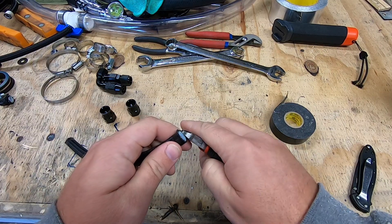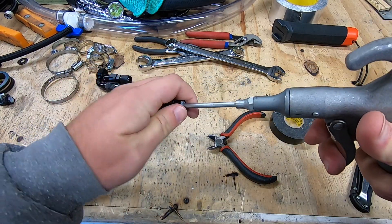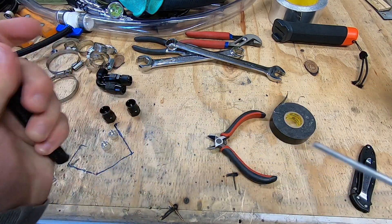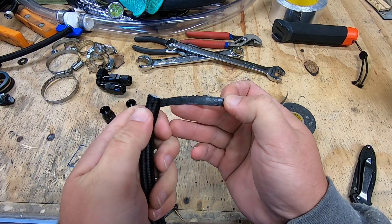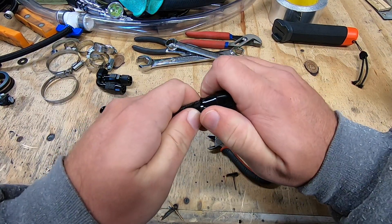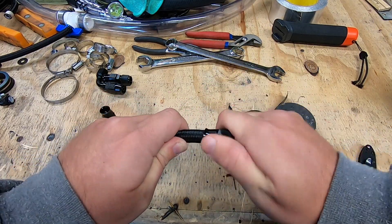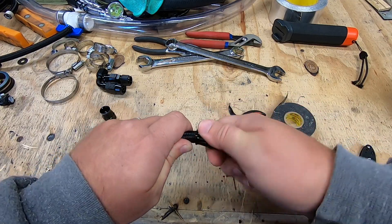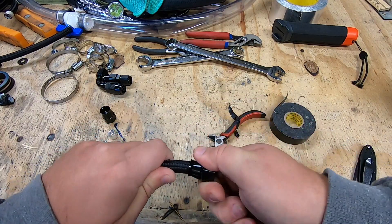In the end, when I get all these made by Aircraft Specialty, they'll all be PTFE as well as having an additional integrated fire sleeve for added protection. For those intending to make their own hoses, be mindful of what you're buying — fittings from one version are not compatible with the other. If you have PTFE line, you can't use rubber steel braided fittings or vice versa. Like most things, you get what you pay for, so the cheapest version from China generally won't serve you as well. We're building an airplane here, so do your homework and choose wisely.